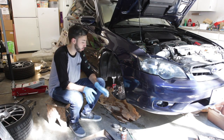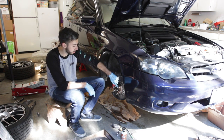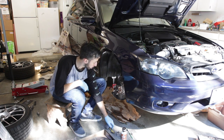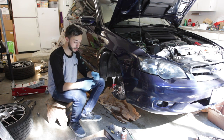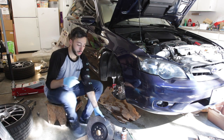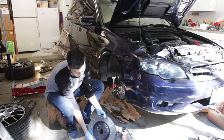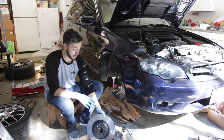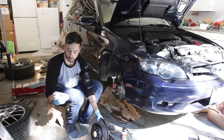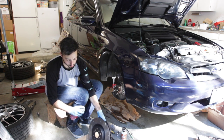We're now at the point where we can actually mount the rotor and caliper to the car. Prior to doing so, make sure you clean off the hub face — a wire brush and some steel wool does the trick. Just want to get off any surface rust before putting on the new rotor. We're using the DBA Club Spec 4000 series T3 on this car. When rotors come from the factory, they have a slight coating of oil to protect from rusting, so take that brake cleaner and clean off the rotor before mounting.